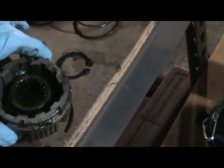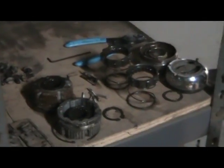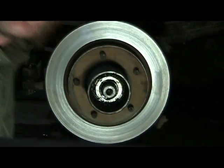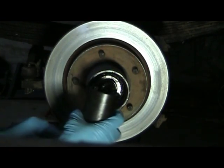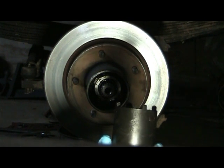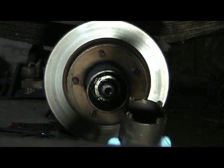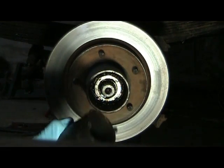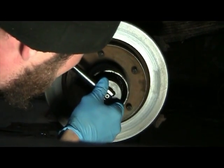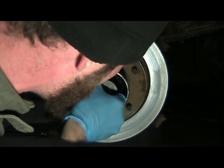The hubs are fairly simple — it's just a little locking mechanism. This inner gear here engages the hub on those splines, and that's pretty much it for the locking portion of the hubs. For the second portion, the first thing you'll need is a hub wrench like this. For the Dana 44 it's a four-spline, and I believe this one works for most all Dana 44 applications. There are two different hub nuts in there; mine weren't torqued really tight, but I used a breaker bar so I can control it a little bit better than a ratchet.